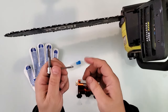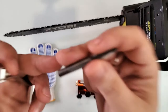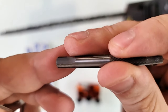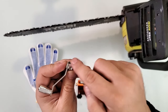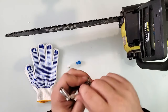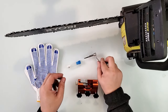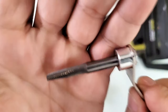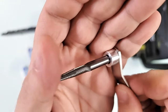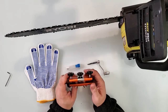It comes with a little Allen key to unscrew the fitting a bit. It has some edges, and you just plug the burr in with one of the flat surfaces toward the screw and tighten it down. Now the handle is ready. This is a really nice carbide burr — it's easy to use because you can do both sides of the chain without switching it side to side.